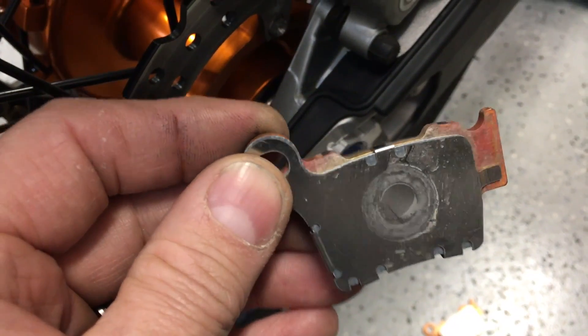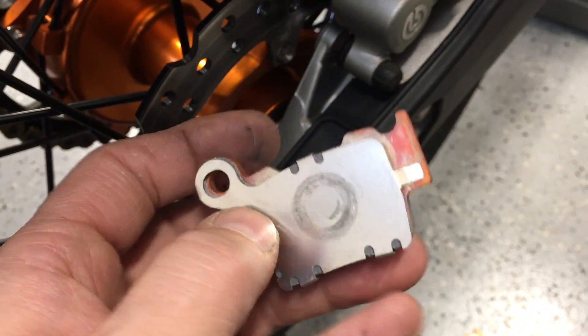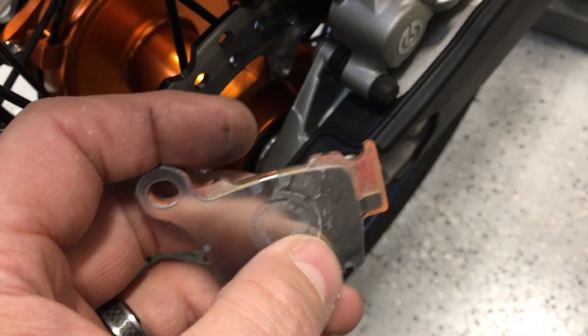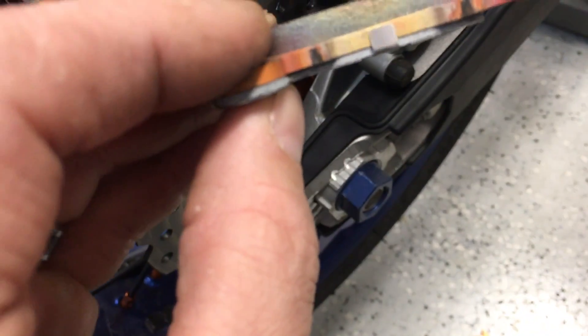The other pad — you can see the circle there, that's what the piston is pressing against. This is what makes noise in your brakes, this is where the squeaking comes from. So I'll put a little bit of lubrication on here. There's a product made specifically — it's a high heat product specifically for brakes.